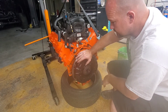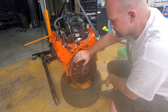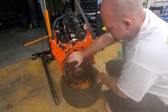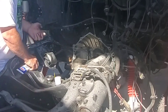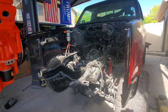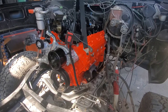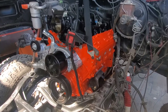Hit subscribe and check out more of my videos — thank you guys for watching. Hopefully this helps you out because some of these parts were hard to combine. The clutch kit wasn't bad, but I wasn't sure if I needed a custom clutch or a stock-style one. Just installing the throw-out bearing now, adding a little grease so it doesn't bind. Everything went smoothly — the engine went in like butter, slid right in, pilot bearing and all. If you have any questions, hit me up in the comments!